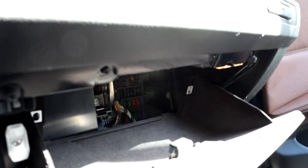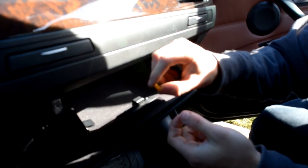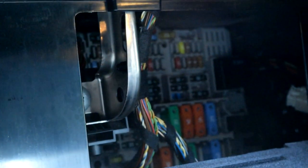Now I'm going to get the new fuse. New fuse looks exactly the same — 5 amps, you see here, it's identical. I'll use my hands this time because it's really hard to get in with tweezers. Just throw that in there like that. Now push it right in and there you go. As you can see, the 5 is right where it was before. New fuse is in, so now we shouldn't have a problem with the cigarette lighter outlets.